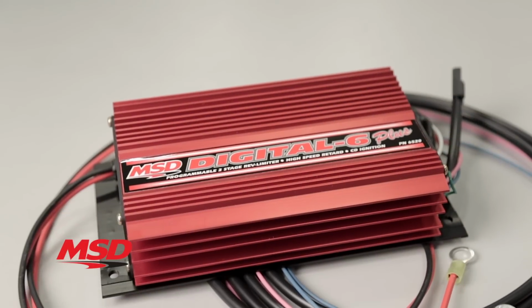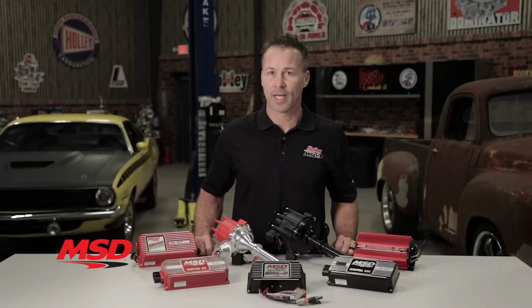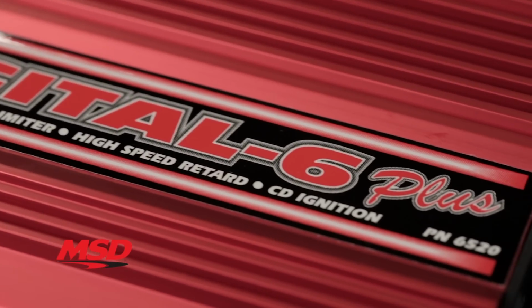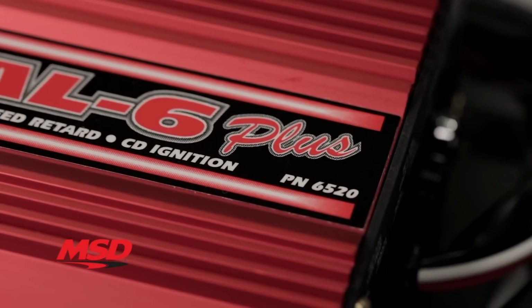Our Digital 6 Plus is a step above the popular 6AL ignition, offering you additional features that put you in control of your engine's ignition. It uses MSD's high-speed RISC microcontrollers to control ignition output while continually analyzing inputs such as supply voltage, trigger signals, and RPMs. Our high-speed controller makes quick compensations to the output voltage, multiple spark series, timing, and RPM limits in order to maintain accurate timing signals to within a tenth of a degree and precise RPM limit accuracy.